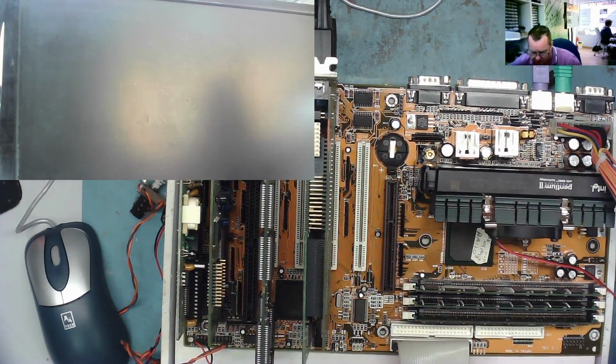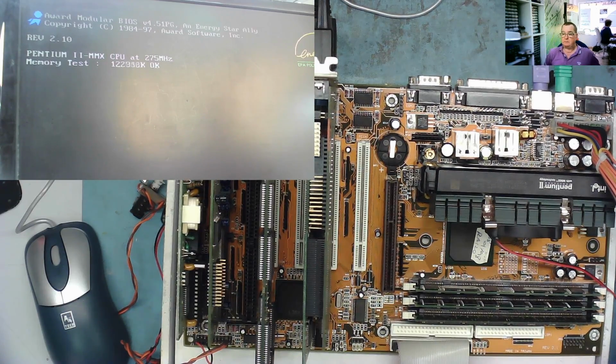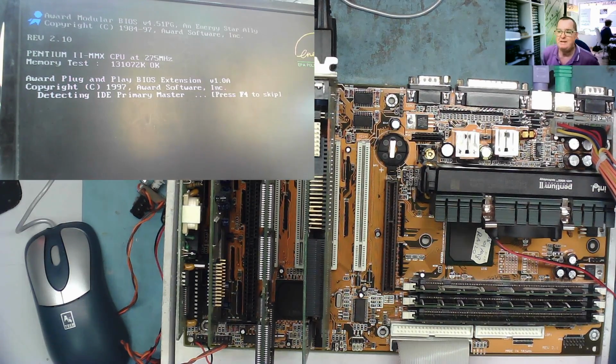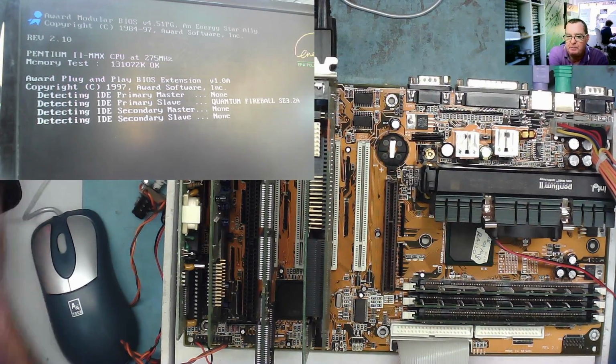Okay, we're ready. Let's go. Let's see if this will boot. Power on. Noisy fan. If anything's failed, I guess it's going to be the hard drive or hard drives. What do they detect? Looks like they might not do. Well, it's found something, it's waiting. Well, it seems to be hanging. Yeah, it didn't find it. Found a second one. But I don't think that was the... Yeah, that's the slave. Let me see if I can actually get it to pick up the first one or not.